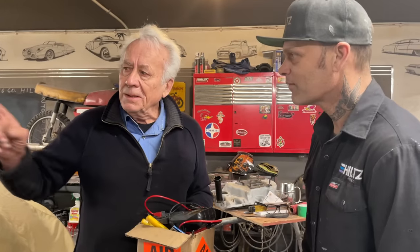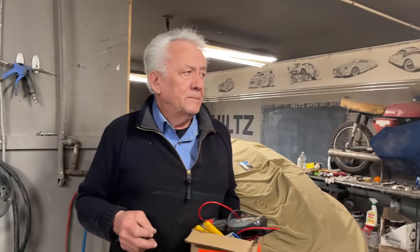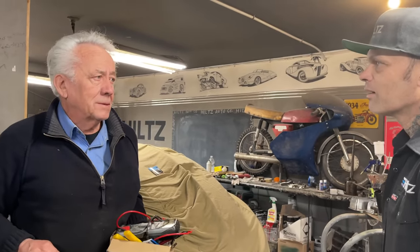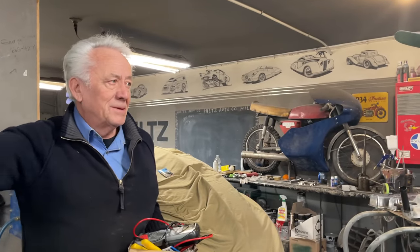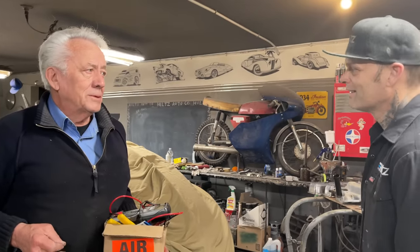Well, the one that really signified that to me. I had an '83, and there's a light in the back of the door to warn people when the door's open. This thing wouldn't go out on this door. So I went to the switch in the door, got the switch right open, figured that'd do. No, sir, light's still on. So finally I went to Peter. The light in the right-hand door back feeds all of them to this door through a diode in the back of the glove box. Now, who in the hell would ever figure that out other than Peter?